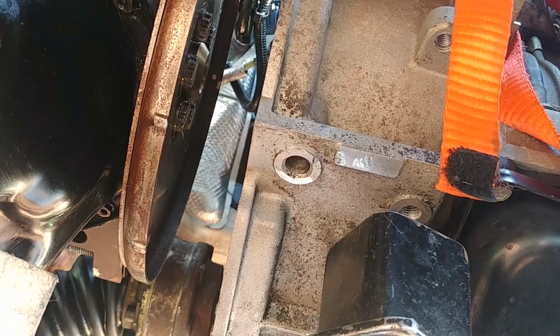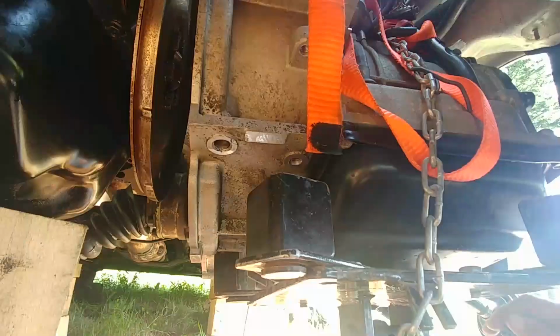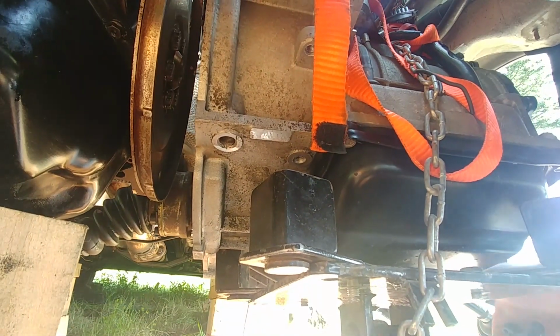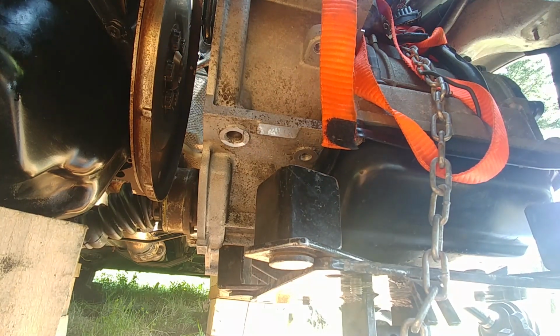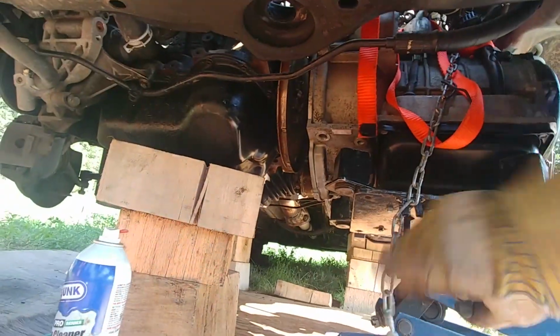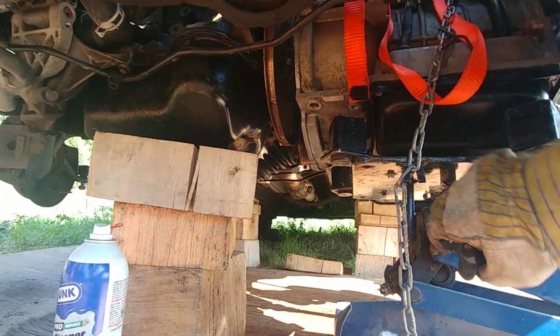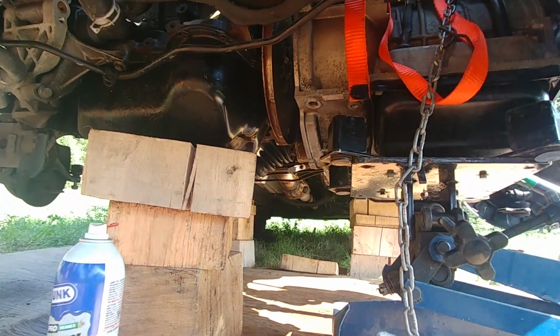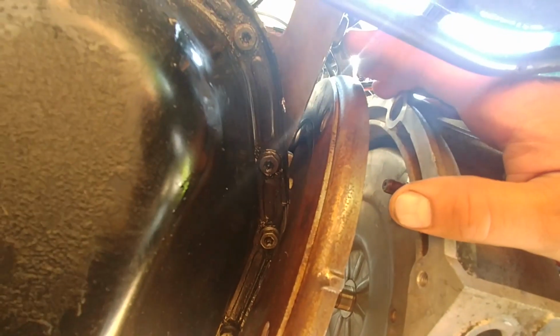Look at that, it's coming closer and closer. Alright, well, close enough. Adjust the tilt of the transmission. Then if you need, adjust the tilt from side to side. Make sure it aligns. You have the 3 dimensions to work on. Alright, check those pins. Make sure they align with the drive plate holes. That's important. Otherwise, it won't be connected.